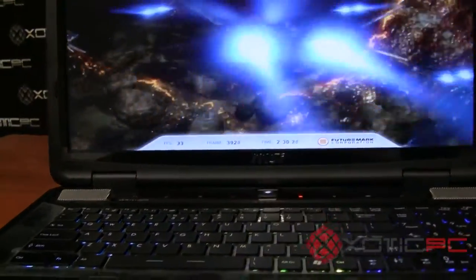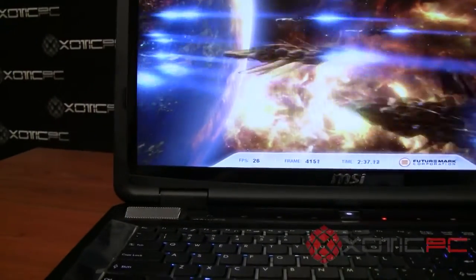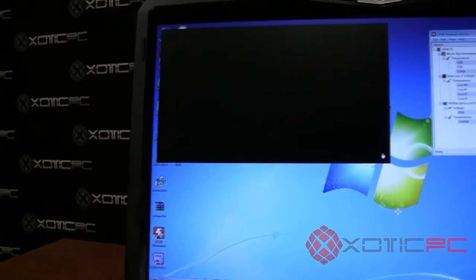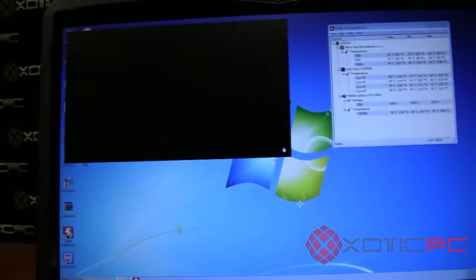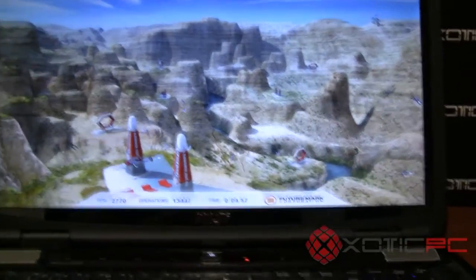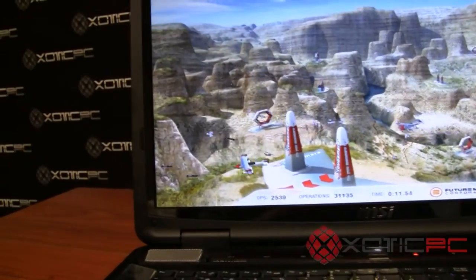The components that this comes stock with are pretty beefy. This laptop comes fully equipped with the i7-2670QM, the new second-gen Sandy Bridge. It comes with 12GB of RAM in a 4GB x 3 chip configuration, which is pretty easy to upgrade. We do have 8GB chips on hand, but check with your salesperson as there are some requirements before you can go over 16GB of usable memory.